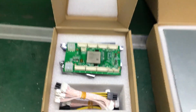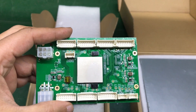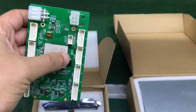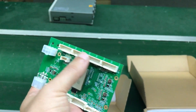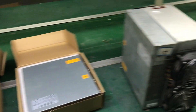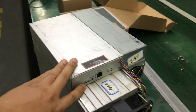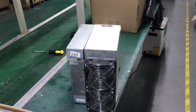The third component is this board — I wouldn't call it a control board exactly. Think of it like a piggyback, similar to what you'd use for easier tuning on graphics cards. This board works in parallel with the original stock control board. It intercepts the signals from the stock control board and sends different signals to the hash boards. It comes with all necessary wiring. You can also go with aftermarket firmware, but some S19 variants don't have the SD card slot in the back, so this board is a good option in those cases.